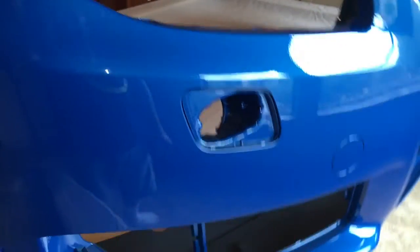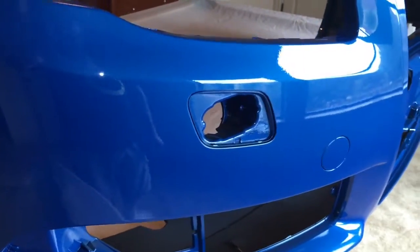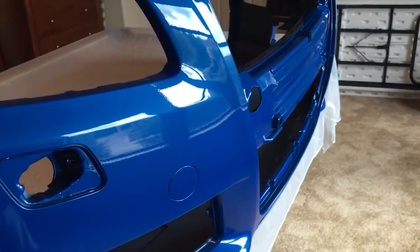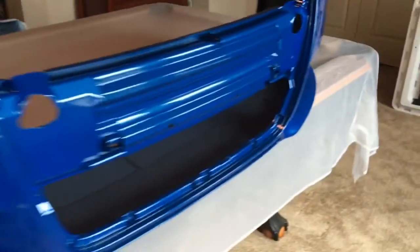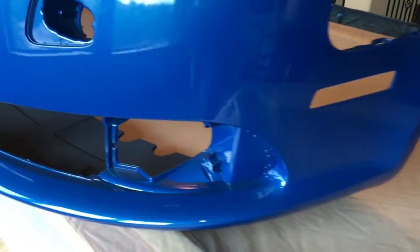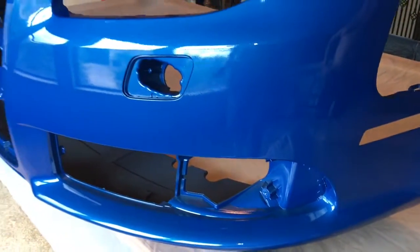But the Audi has almost no orange peel, and so he'll be color sanding it to get it flat. There are a couple of little dust nibs here and there — see, there's one right there. But that should disappear with the color sanding. And then the fenders downstairs, he's about to shoot the hood, hopefully before the rains come.